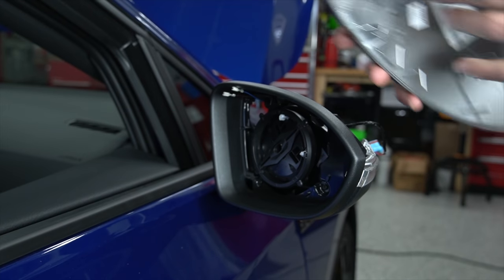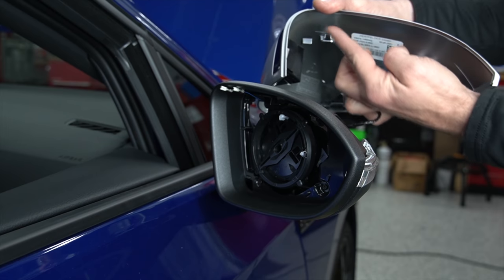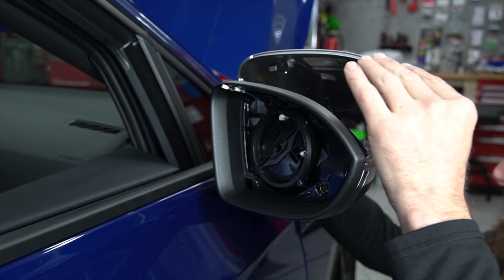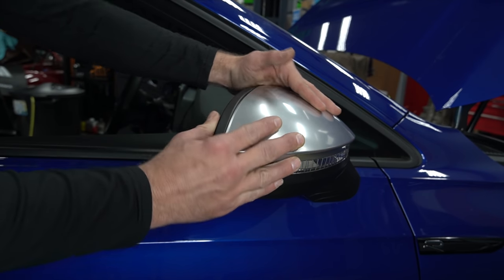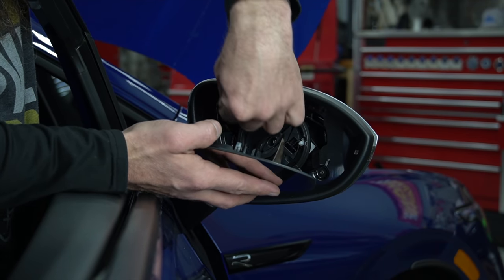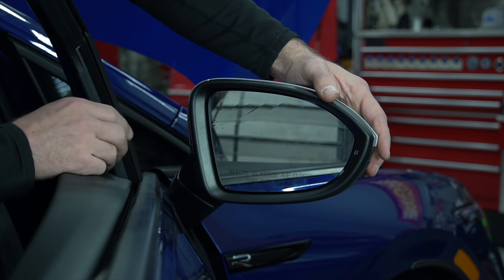Now we have to put our mirror cap on. Remember we have a plug here, and make sure your mirror heating wires are out through the opening so you don't have to dig through after. Plug that in. These two tabs here and here are the tabs that click into the housing — make sure those are good to go. Get our mirror cap on — it goes on the same way it came off. It sort of slides into place. Be careful as you roll it over, make sure it clips into place and everything is lined up properly. Finally, put our mirror glass back in — hopefully you did a better job than I did. Get our heater plugged in just in case, and carefully snap your glass back in. Usually going back in is no problem — it's getting it out that's a super pain in the butt.